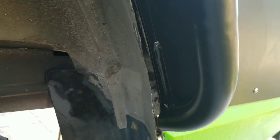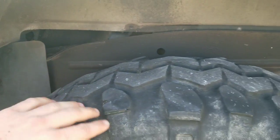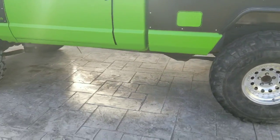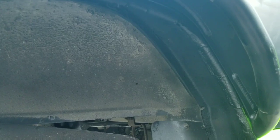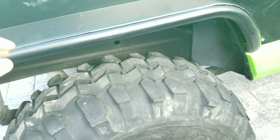The rear, this one, I kind of cut past the pinch weld. You learn from your mistakes, you do it once. The other side, I cut slits in it, hammered it up, and folded it just kind of like an XJ rear fender well. You just cut and fold the material. But everything's all mounted up. It looks great. I cut slits into everything and then hammered everything up and folded it back. That's what I should have done on the other side, but I did the driver's side first, so I did end up cutting past the pinch weld. After looking online, I realized I should have done it like this. So you live and you learn. I'm probably gonna re-weld that inner fender back to the outer skin and try to fix it as best I can. But for now, it looks good from far. You can't really tell. It's a 10-foot paint job either way.